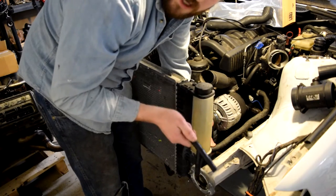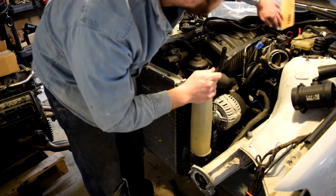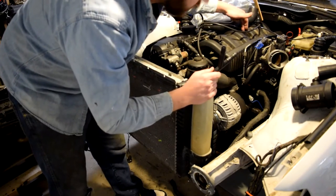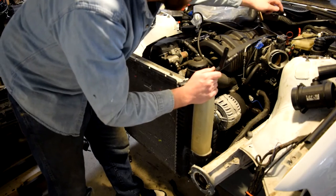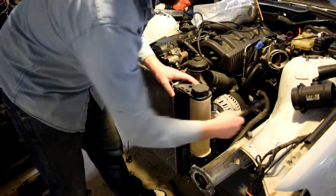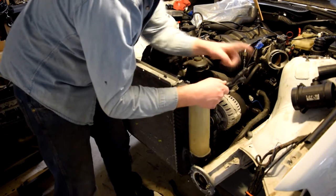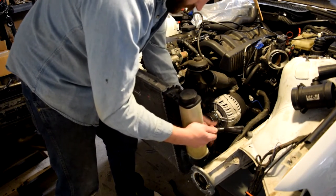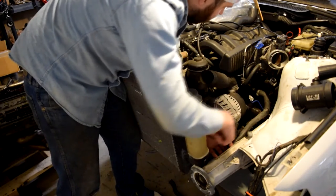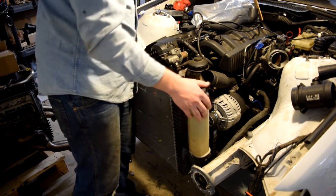I'll leave the part number in the description. So I'm going to cut this here and pop that in here. The reason for the Y connection is that, if you're looking into the engine bay, on the left side of the heater core is where it goes in from the engine into the heater core. On the right side is where it comes out. From there, I'm going to get another piece of hose, which I don't have at the moment, that goes from the out port of the heater core down along here into this top part of the Y. That way it drains into the bottom of the reservoir, so I have the excess from the engine and the return from the heater core running into the bottom of the reservoir. So that's what I'm going to do first.